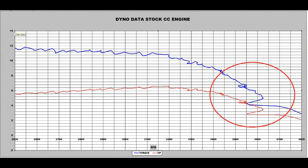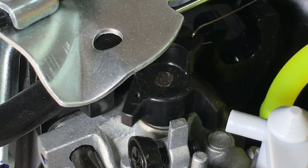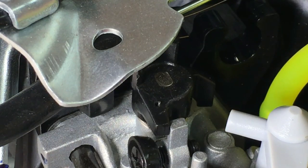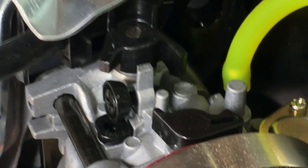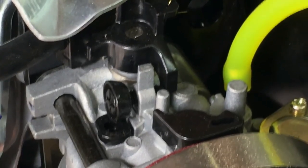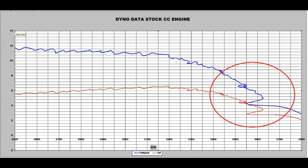Over on the right side of the chart we can see some wacky stuff going on. Keep in mind this engine is operating under a governor and it takes time for the throttle to react to the load, but I also think something else is going on. On closer inspection it appears the throttle linkage is binding or the governor is not properly adjusted. When the dyno load is applied, the throttle just isn't responding like you'd expect it would. This video is about the performance of a box stock engine — perhaps what we're seeing is normal, and overall I think it's a minor issue.